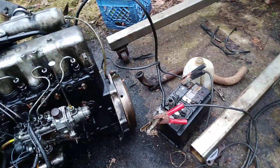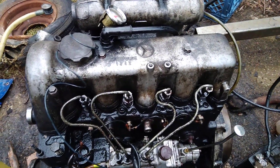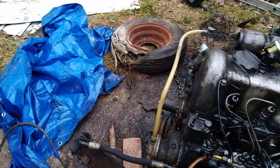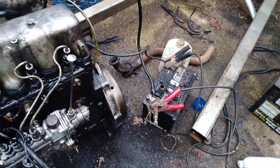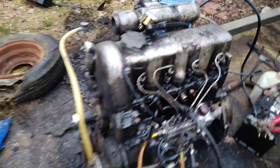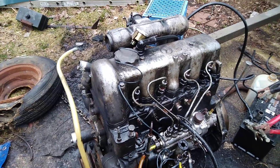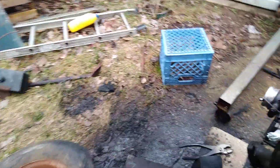It's starting a lot better. It's still got to have the glow plugs — I think it probably needs injectors, that's part of the thing. I cleaned them but I'm not sure, and they're expensive. It'll usually start as long as I put the block heater on it for a minute. I think it's mainly because it's been sitting for about 20 years — my nephew had it for years and it hasn't been run.